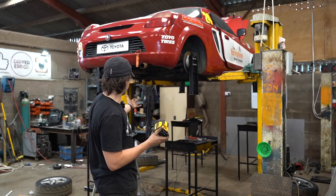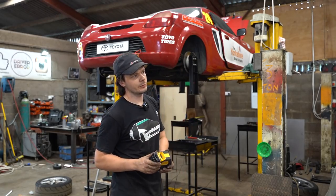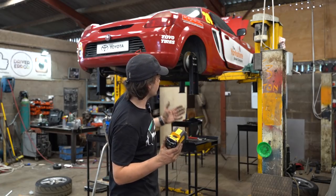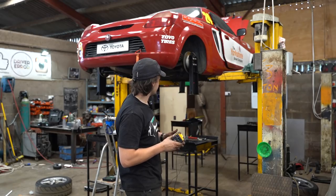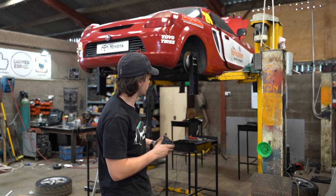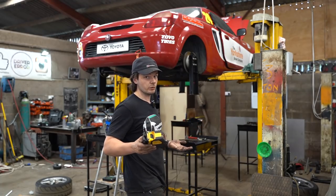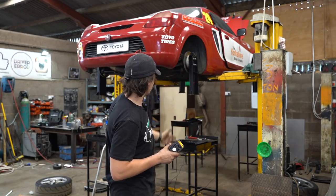I've set up the tables now. I've got the scales out, I've got the wheel stands on. I've taken the coilovers off and I'm trying to set the bump stop properly. When I first installed these coilovers I did some things I probably shouldn't have done, which I think caused them not to perform at their peak. I've been here about seven hours today already, so we're just going to get an idea where the weight is. We've got about under 20 litres of fuel - I've still not fixed the fuel gauge. We're going to weigh the car and then put some ballast in to cover for me at about 83-84 kilos, and then we'll be able to see where the cross weights are.